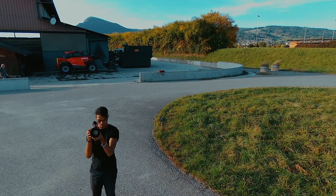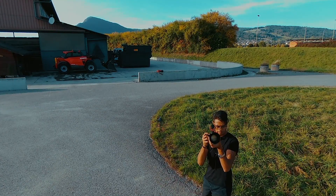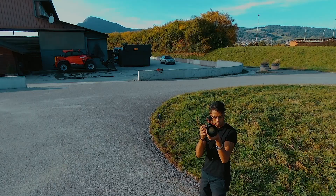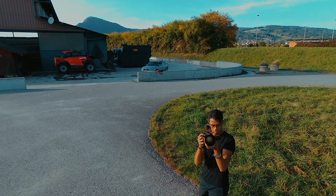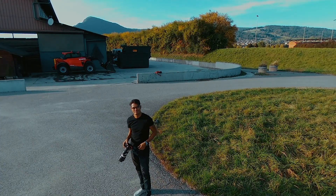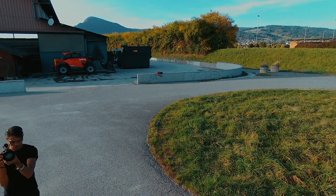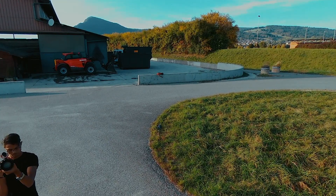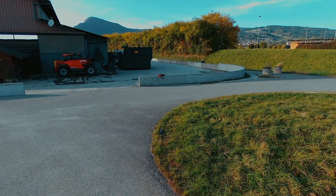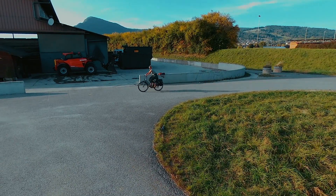Last but not least, this is the footage after I put the two best balanced propellers in the back of the drone. The back legs are not wobbling now — it's the front legs that are wobbling. I figured the batteries are in the back, that's the heaviest side, so if vibration is going to have a good chance of going to the camera it's going to be from the heaviest side. You can see in this video there's little absence of jello — I really can't see it. It is a lot better than what I was getting before with all four propellers unbalanced. I will work on the other two propellers and post another video once I've gotten all four legs to not wiggle as much and operate as normal.